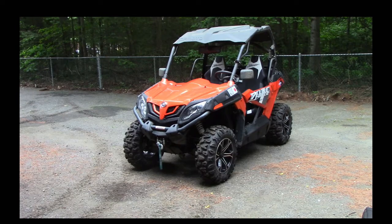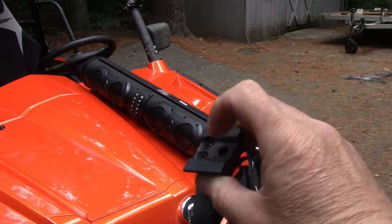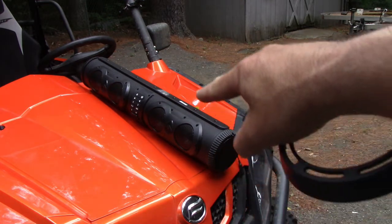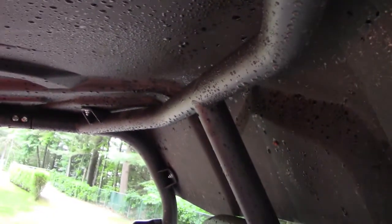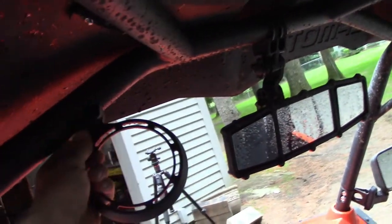But there's going to be some issues involved — let me show you. So that's the speaker and it's not terribly heavy. It needs to be mounted and can't just be zip-tied. They have these brackets on the end that go on there, and you'd have to go up and mount it to the roll cage somewhere. They also have holes along the top for other secure points. But the problem is this machine has no straight pipe to accept the brackets. No matter where you put this bar, there was no place for these to hang — because this is at an angle, these are at an angle.